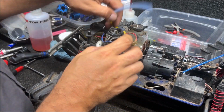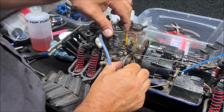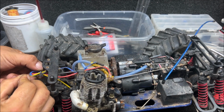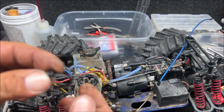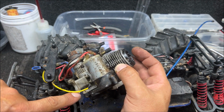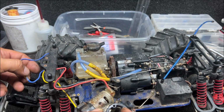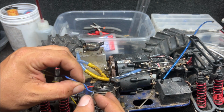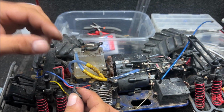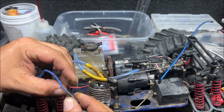So I just take the engine straight off when they're locked up. So when you're restoring these, you don't have to cut the zip tie. Just get a safety pin or a needle, and that way we reuse the zip tie that came off of it. Okay, so they did have it hooked up right. Easy start. The wires are in very good shape. The plug in very, very good shape. But they were putting it on like that. You don't do that. You need to get some needle nose pliers so you don't destroy this wire.